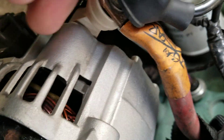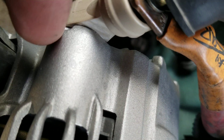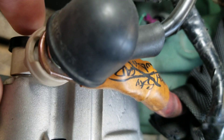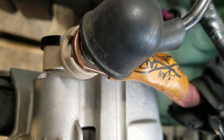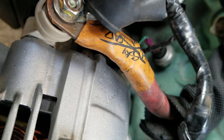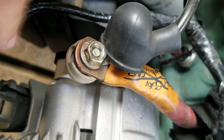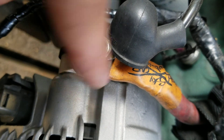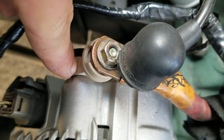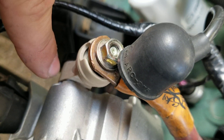This post right here — usually it's pointed this way, and this little dimple right here holds it in place; there's like a little finger on the back of this post. You can take this little black cap off, and there's another 10-millimeter nut. You can't actually put your power wire on that post because that post is actually skinnier than this one — it's a six-millimeter thread. So you can't actually use it for your power wire.